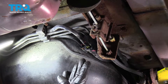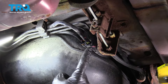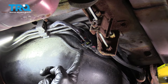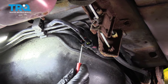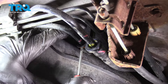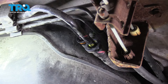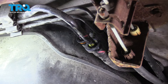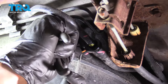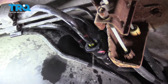Now we're going to start disconnecting the fuel lines. Up along the front of the driver's side of the tank you'll find two lines. To remove these lines, use a small pocket screwdriver. For the orange connector, press in on the tab, gently press it up, and once pressed, slide it off. Make sure you have a nice collection bucket under the area. Go ahead and pop that right off.